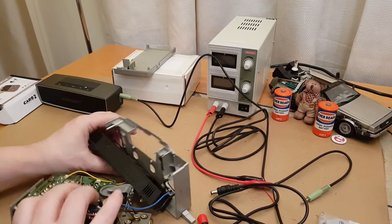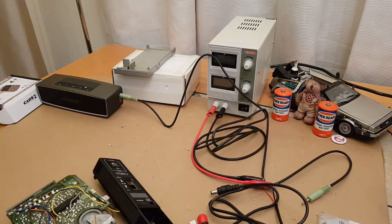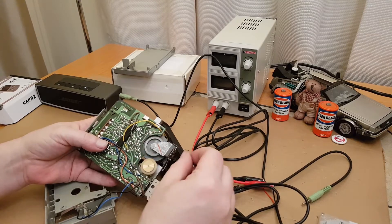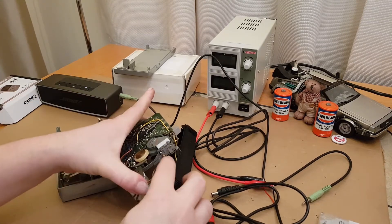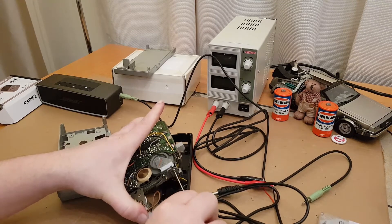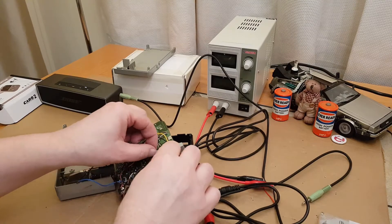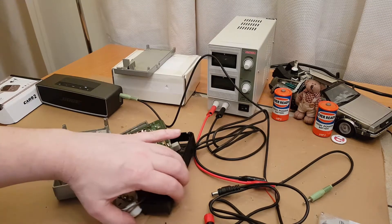We want to try and replace the belt now. You can take the belt off here — it comes off but it's stuck by this piece of metal. There are two screws here — I don't want to take it off altogether, I wonder if I can just undo it slightly. There we go, we can take the belt out now.